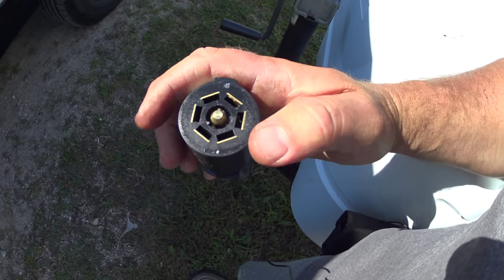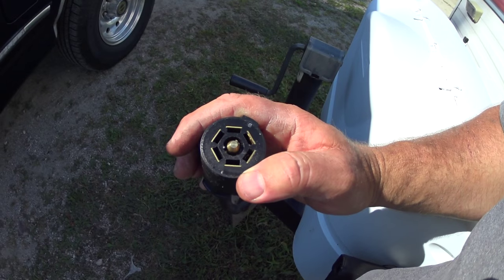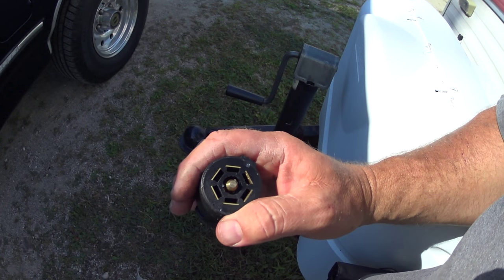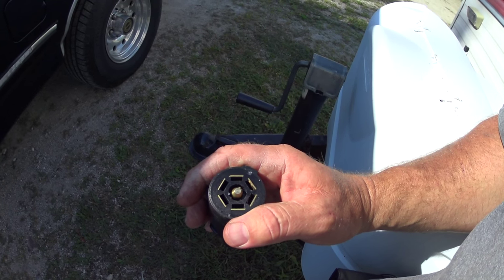The thing I wanted to point out is the connectors themselves — you can see they're kind of on one side only. The old one had connectors that were pinching the blades on the truck. Now, is there more surface area on the new one-sided design? There is more surface area on one side, but the old ones, although smaller, had two surface areas — one on either side of the plug. Those plugs on vehicles are like a folded-over piece of spring steel, and the connector slides on and rubs along the sprung side for its connection. The old one had a pincher style that would clip over it. It's just apples and oranges — I don't know if one's better than the other, but it's done.